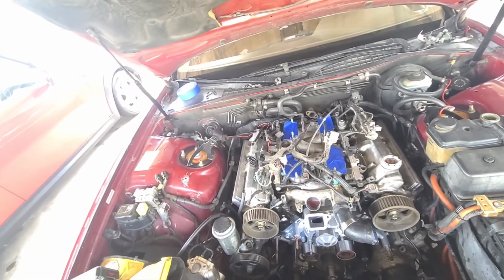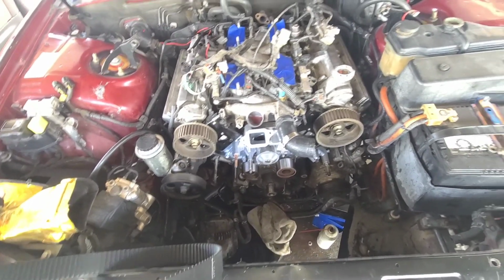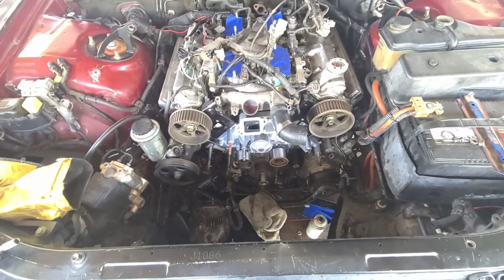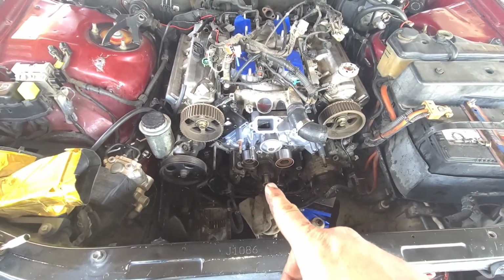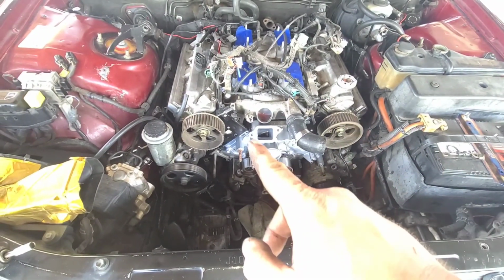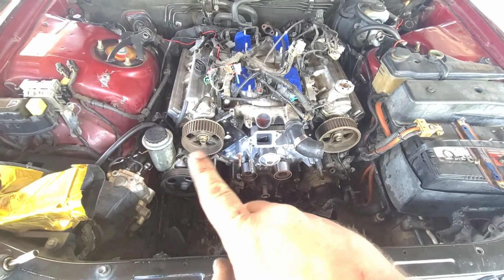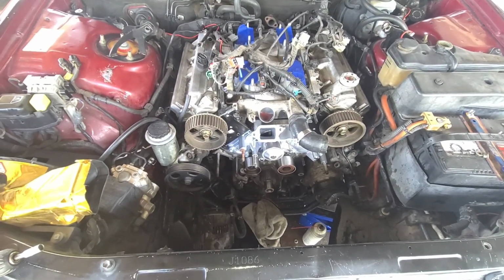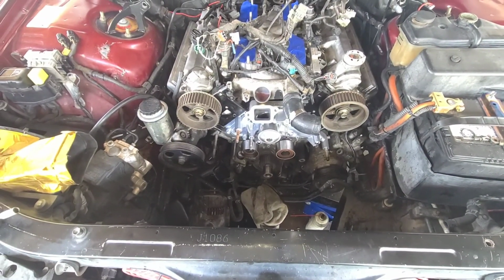Crankshaft. You line those up with the timing marks, and then you just release your tensioner. But there's a process to this, and you got to make sure you do it right. The way I do it, I always start from the opposite side from the tensioner. So we'll wrap it around the crank. We'll go this way, up over this, down there, and over here. And we'll make sure all of this over here has tension on it, it's tight, and all the slack's right here. So when you release that tensioner, boom, it locks it all in place, and you don't have any slack anywhere in your timing belt. So I'm going to go ahead and start doing that, and I'll show you when I'm done.